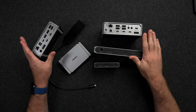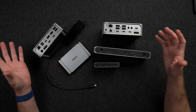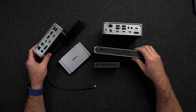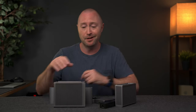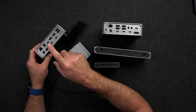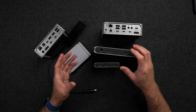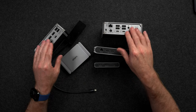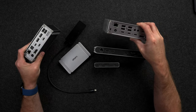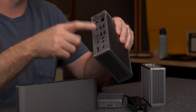The last question I get frequently about docks is about daisy chaining. If you are someone who needs a massive amount of I/O ports, you can daisy chain docks together and keep the one-cable solution for connecting to a laptop or desktop. In my opinion, with that many ports, you probably want to use at least one other port on the MacBook for connecting devices. That is because a single port on the Mac will only get 40 Gbps. Once you connect I/O-heavy devices like displays or SSDs, you can start hitting that 40 Gbps limit on the connection from the dock to the computer. At that point, you may want to use a second port on the Mac and get two separate branches of 40 Gbps. So if you connect a second dock to a second port on the Mac, each dock will get a full 40 Gbps of bandwidth.